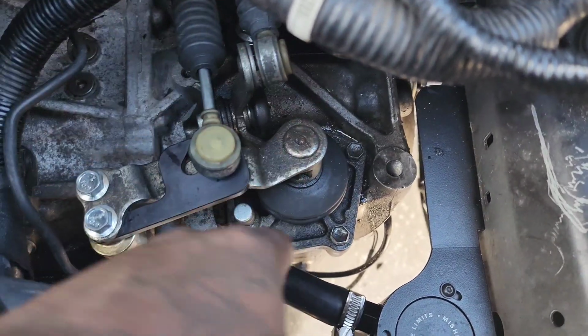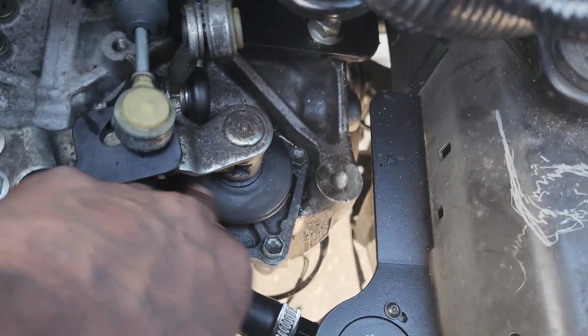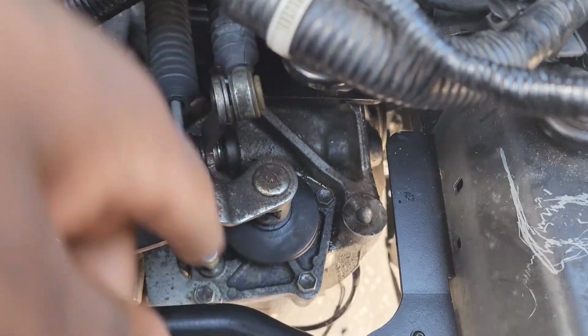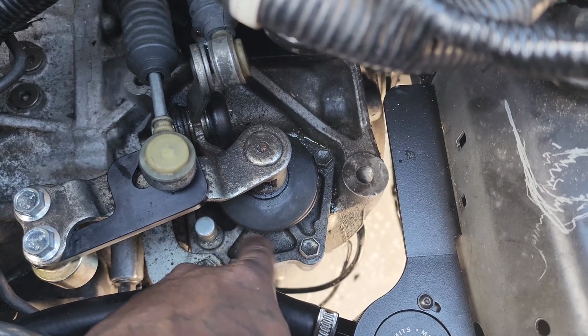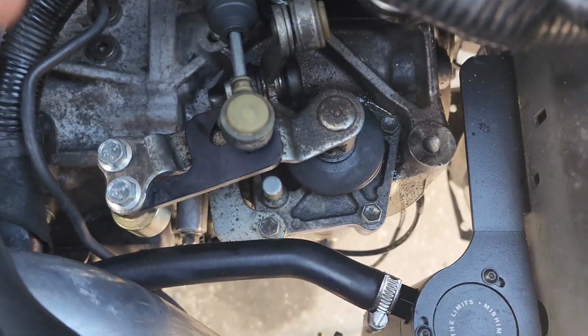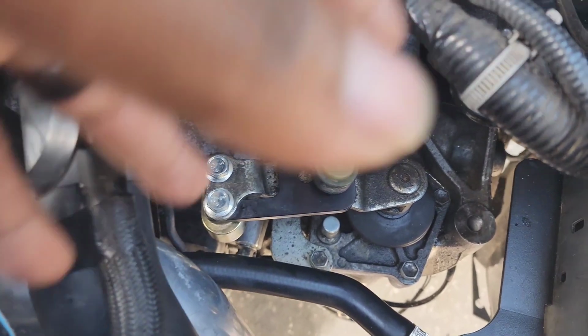It's very common. So what happens is there's a seal inside this rubber, like under this rubber here. It's called a pivot shaft seal. That just means the seal went bad and you just have to replace it, so that way it's not leaking anymore. Mine is all dried up, but it happens over time sometimes. I just have yet to get to it. I already have the part.